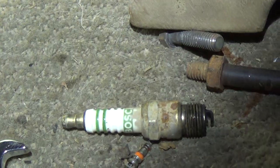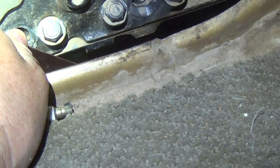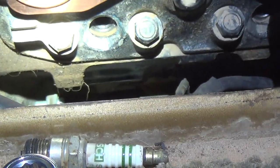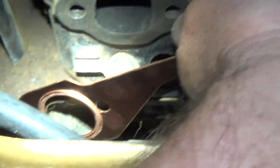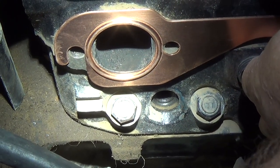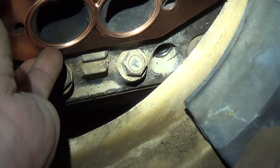I haven't started this thing up yet, but I have got the other side on — which I'll show you in a moment. Round port headers will work with square port heads, which is kind of weird — like from grade school, round peg, square hole doesn't work. But because the backside of this gasket is nice and flat and the sealing surface is quite thick — probably at least a quarter inch thick — it's going to seat right up against the backside of the gasket very nicely.